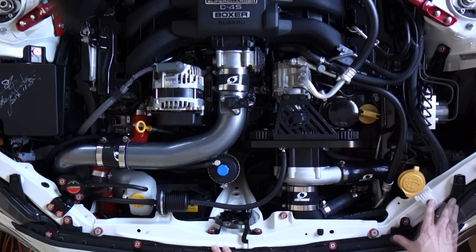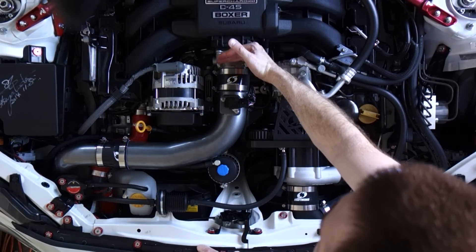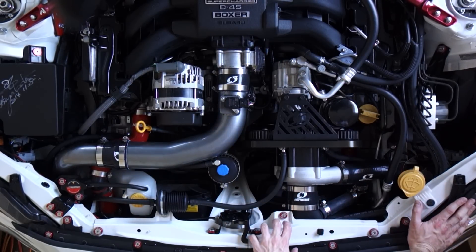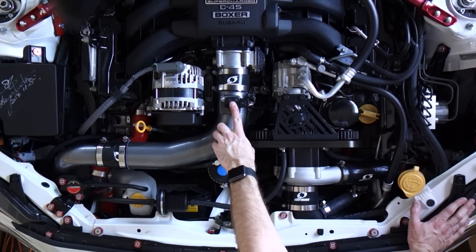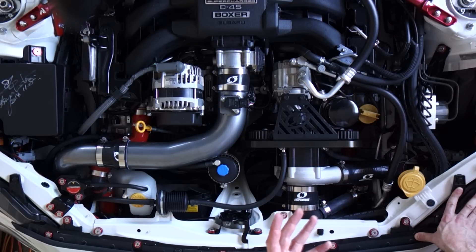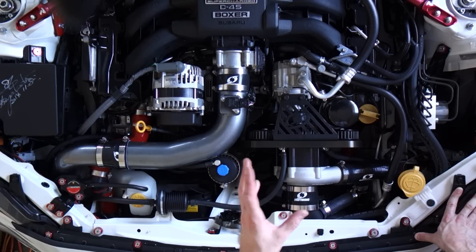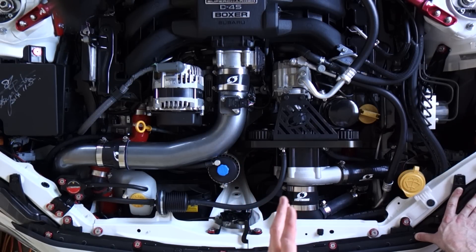How to understand that issue is simply the position of your airflow sensor. We've got our airflow sensor here, and you can imagine that as the air comes into the engine it's pressurised, it comes out, comes up the piping and it's measured by the sensor. The function of that is to tell the engine control unit - the ECU - exactly how much air is in the engine at any given point in time. That's absolutely critical to engine performance because the engine needs to know how much air is there so it knows how much fuel to inject to create the perfect air-fuel ratio for combustion. If you've got more air in the system than the ECU thinks there is, you're going to be running lean, which means a hotter explosion - very dangerous for the engine.